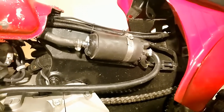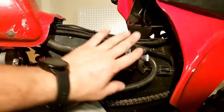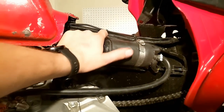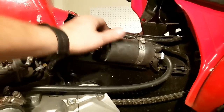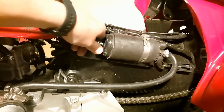You could run that oil pump and this fuel pump together and be fine, plus something else. I think I'm only running like 6 volts. You only need fuel pressure to be about 2 to 3 PSI over the boost you're going to run — so if you're going to run 20 pounds of boost, you need about 23 PSI of fuel.